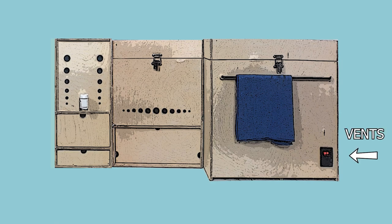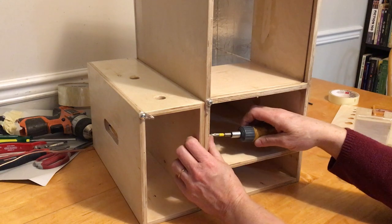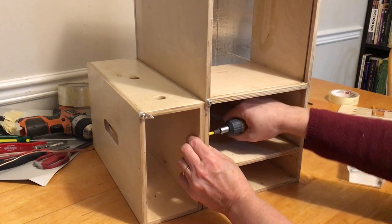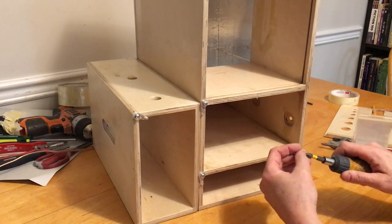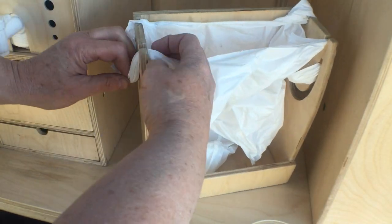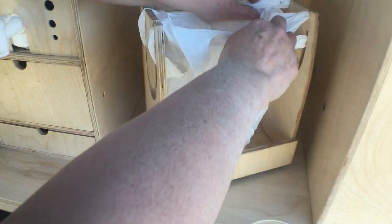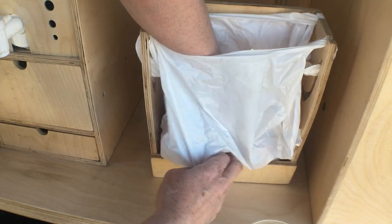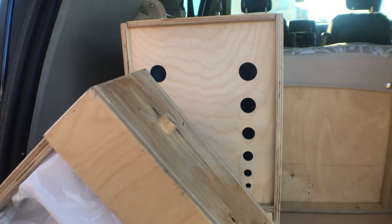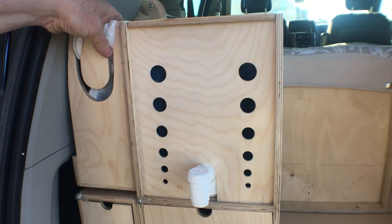This will also leave more room for air to circulate around the vents. So back in the woodshop, I built new boxes for the garbage compartment and the condiments drawer and attached them to what was left of the water box. The new garbage section is made to hold a plastic bag and was shaped to use the space available in the curve of the liftgate opening. This is actually the second version of the second garbage box. In the first version, the whole thing was one piece, but I redid it so as to have the garbage compartment separate to make emptying it easier.